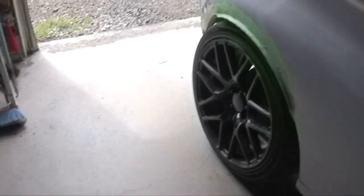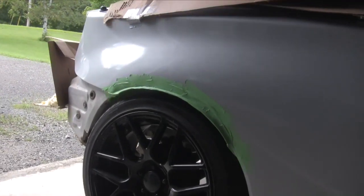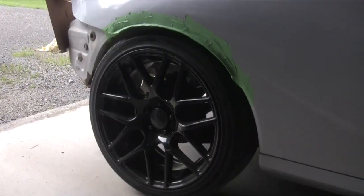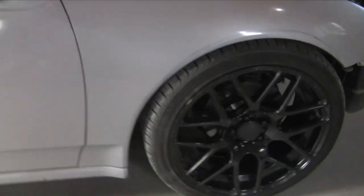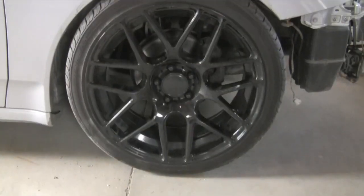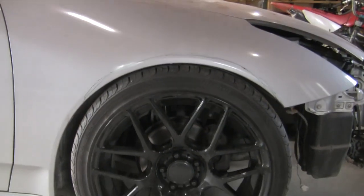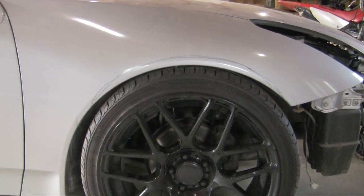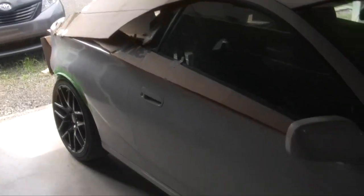I have cut the rear fenders, so it gives me some more clearance. Hopefully now when I hit a bump, it will not hit the fender. That was fun, because I didn't really have the right tool to do that. This is kind of interesting. This is after lowering the front tires, the coils. Believe it or not, there is some clearance there. You can't quite fit your finger under there. On the other side, I did cut the fender and folded it up a little bit. And I just started playing around with some cardboard to try and get some lines made.